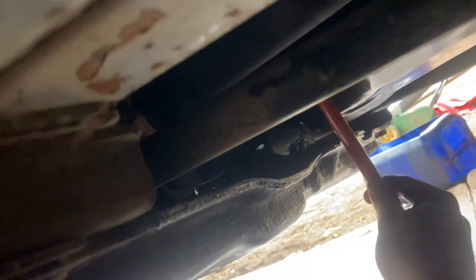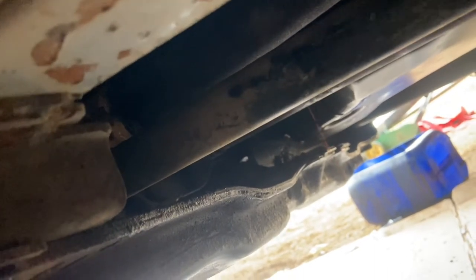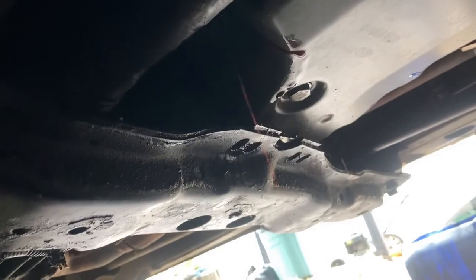Let it idle for two to three minutes and then check the fluid. Looks like we're missing just a little more, so we'll pump another half a quart. And boom — half a quart in and it starts to overflow lightly. Time to reinstall the plug. Transmission servicing is done.